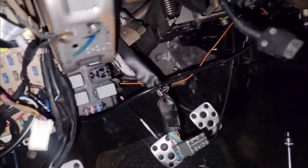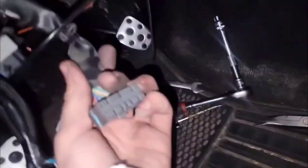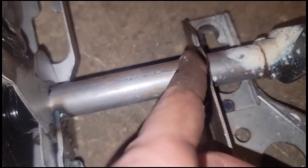Got everything freed up. Now I just gotta figure out how to take it out — it's gonna be the fun part. The whole thing is free but it didn't want to come out because it's in a tight spot. What I did was take this piece out, disconnect almost all the wires right here, and take this box out right here. And that's it. So that's the crack — it started at the weld. Underneath the car it looks like it goes all the way around to the other welds — only this much metal is left before it's completely cracked.